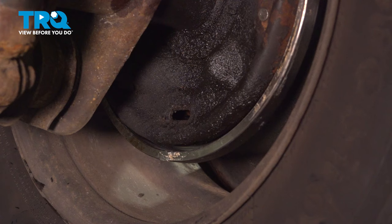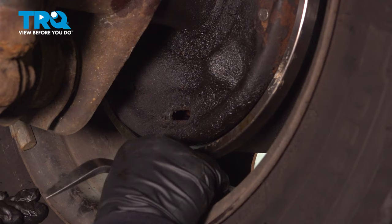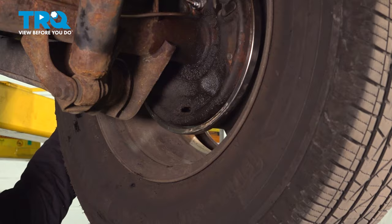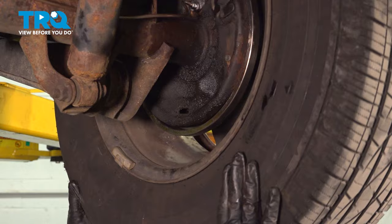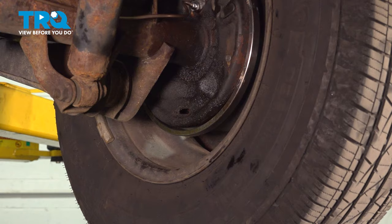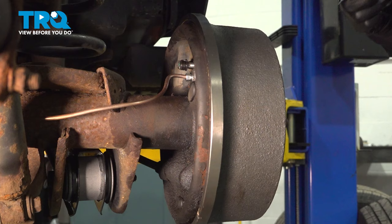Now to do this properly, you can mark it. If you do it from the outside, you can spin it and check for the valve stem right through here. I'm going to spin this wheel — I want it to get a full rotation before it stops on its own. That's perfect for me, because as you go down the road, drum brakes and shoes actually expand just because of the heat, and you don't want it over-tight because it will lock the wheel up, and under-tight will give you a low brake pedal. I like the adjustment — I have just the right amount of drag. I'm going to put that boot back in.